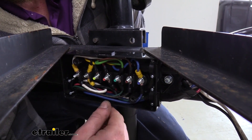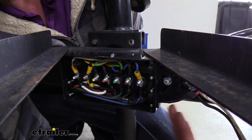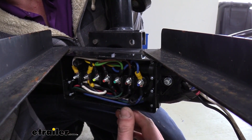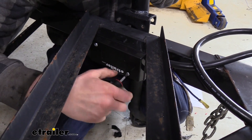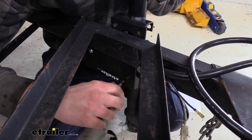There are five different entry and exit points on the box that you can access. We've got top and bottom on the long part, two on one side — which is what we're using, in and then right back out — and one on the back if you wanted to go in with one wire and pass straight through. When screwed down tight, our cover will keep out any dirt, debris, and moisture, ensuring long-lasting connections on all of our studs and components hooked to them.